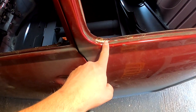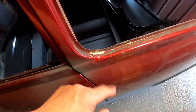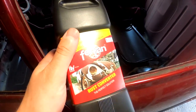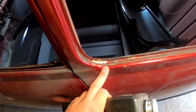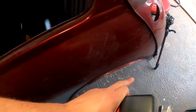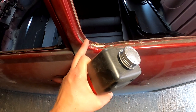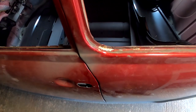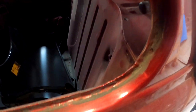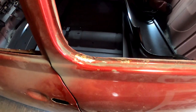So what I was thinking while I'm here is we can get the wire wheel out and give this a bit of a go. If I dig that out and make sure there's no rust in there I can kind of call this quarter done. The only last bit would be this tiny little piece down there, which is like an inch. We won't do that until we finish the boot floor on the back panel. The rest of the window aperture is really decent on this car, so let's get on it.